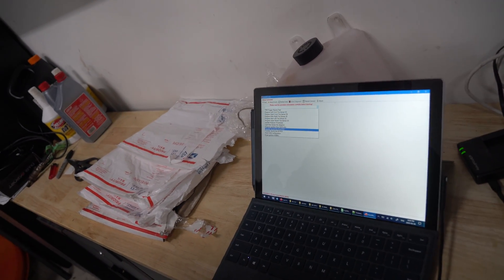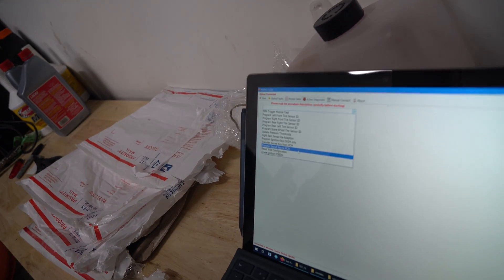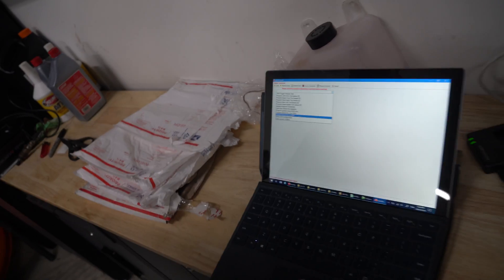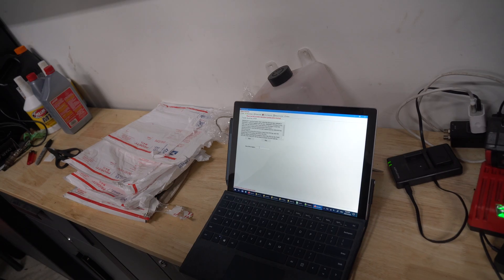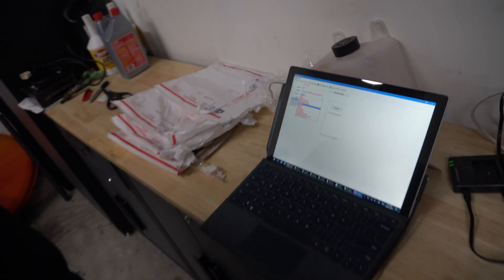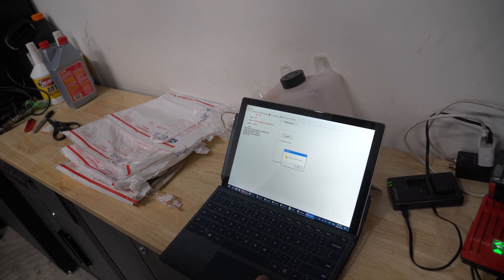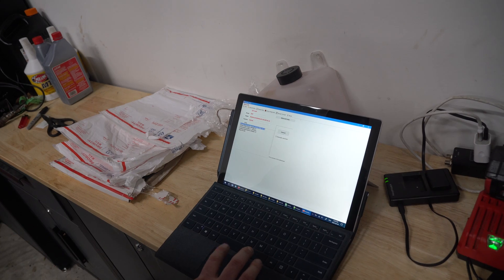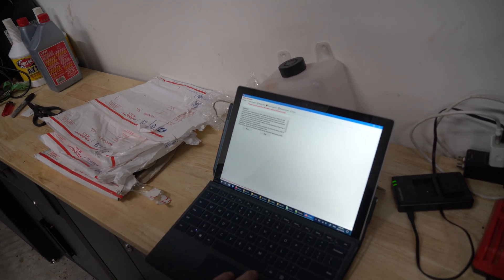Then you would go through here: Transfer Secret Key from — yep — to the PCM. I'm not going to show you this part, but this is where you would put that key that you received. This time we're going to connect to the engine module — click on there, hit Connect again, just make sure you select the right one. We're connected.